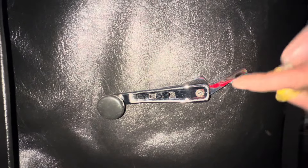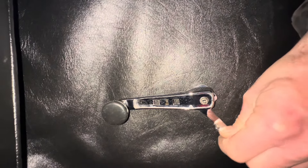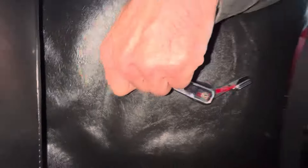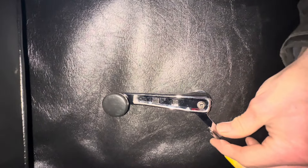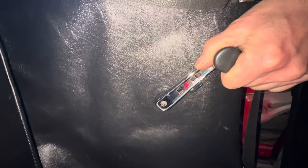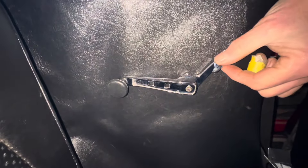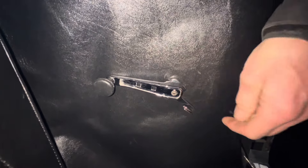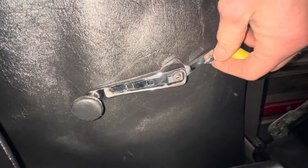To conclude: when this little leaf is up here the hook is in the locking position; when it's down here the hook is moved back out of the way. When this handle is moved up towards the sky with the lever and handle together, the hook is pulled down and the roof is pulled tight to the car. So that puts the hook up and releases the hood, and that puts the hook to one side. If you're taking the hard top off or putting the soft top down, the very first thing to do is move this handle to this position, which will move the hook up. Then move this lever down and that will move the hook out of the way. This lever only moves the hook from side to side — it doesn't move the hook up and down and it doesn't release the clamshell.